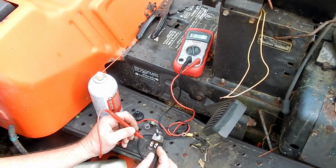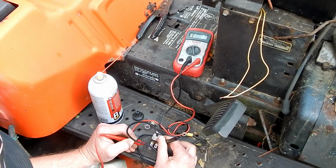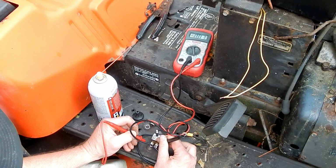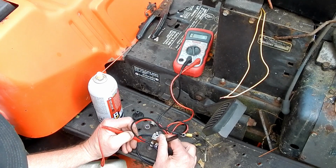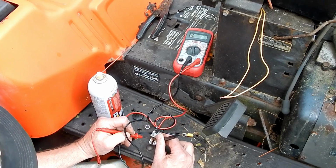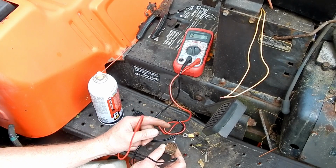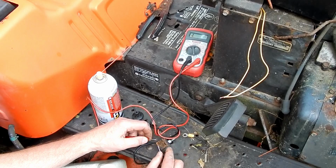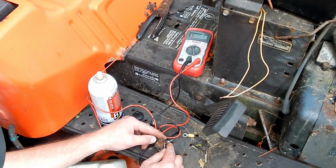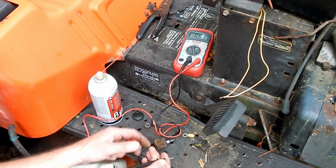If I pull it, which is the on position, boy, I can't get continuity in this thing at all, no matter what. Oh, wait a minute, here we go. Continuity between the 2 pins there when this is pulled, and not when it's off. So let's see. So I bet when it's pushed in and the PTO is off, you're probably supposed to have continuity between these 2 rear pins. You do. They're not great though. There we go. Yep, now we do. Huh.